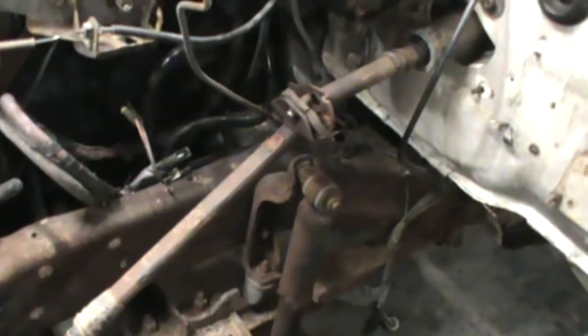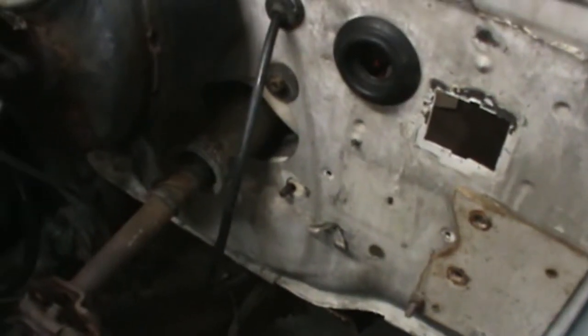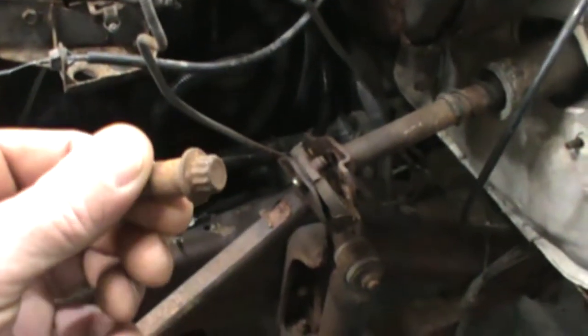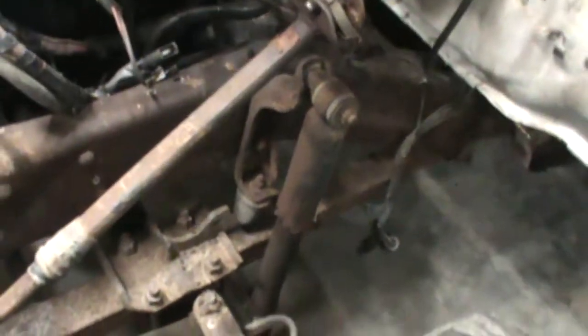On the steering column and steering shaft, I've got everything loosened up — I just wanted to show you a few things before I actually pull it out. There are about three seven-sixteenths inch nuts there. Make sure you don't loosen those up until you get your steering shaft loosened up first. I had the cheater pipe out trying to get those loose. For what I think are Torx-head bolts on the shaft, I used a three-eighths inch 12-point socket and it worked. And that's a 10-millimeter down here. Once you get the shaft off, you can loosen up your steering column and pull it on out.